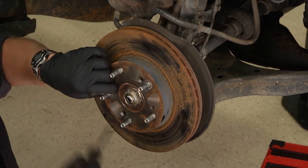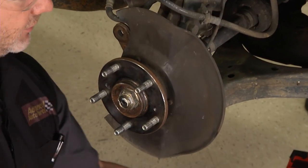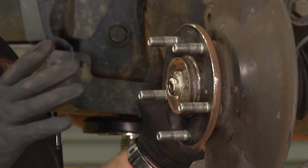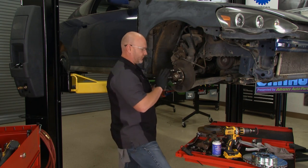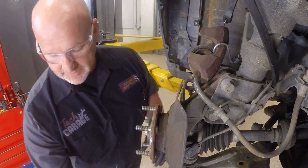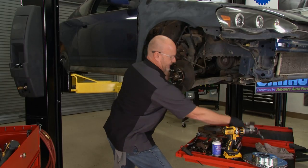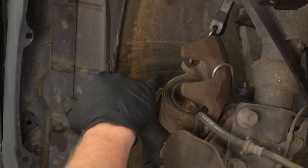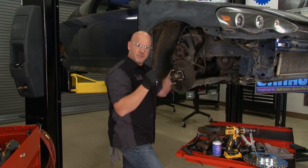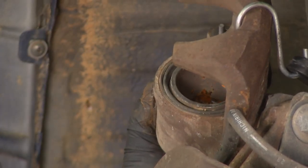Final retaining screw out of the old rotor — you can see she's got a few years of experience, a lot of oxidation. Inspect the hub assembly surface — you want it clean and rust-free. We're going for performance here with heavy suspension loads, so we want the truest possible tracking and maximum stopping power. The caliper and caliper mounting bracket are removed, held up with a bungee cord. Before compressing the caliper piston — you can use a C-clamp or a compressor tool — we checked the dust boot: no cracks, no seal issues, it's doing its job.